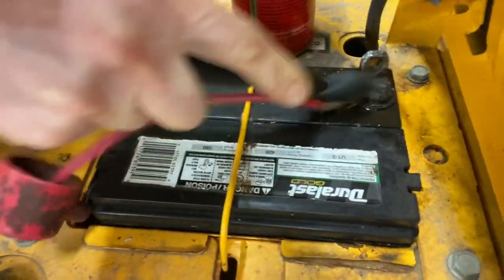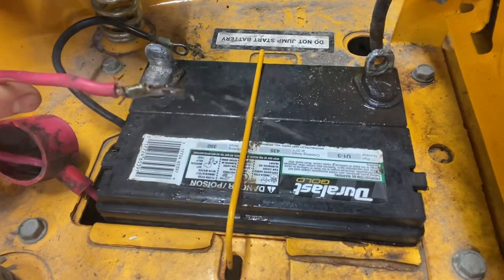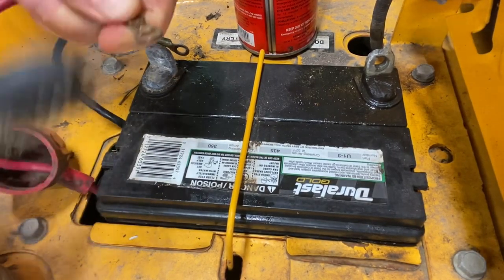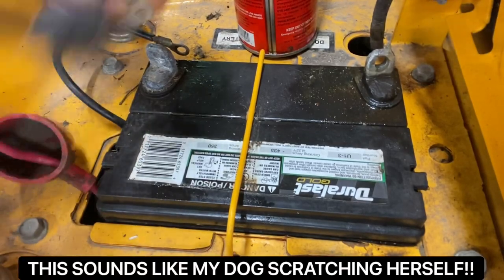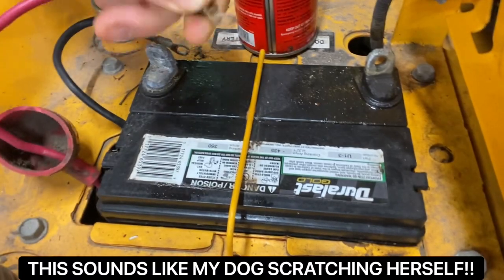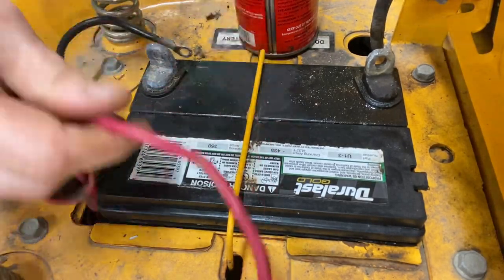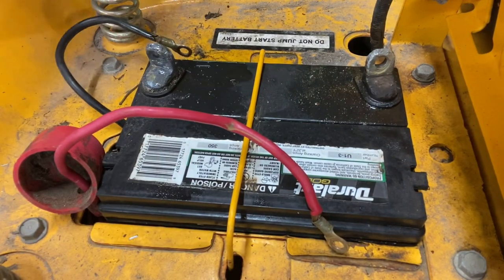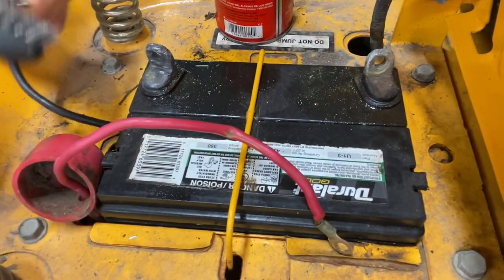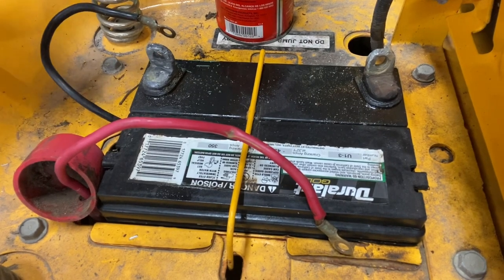As you can see, especially on the positive terminal, there's going to be a lot of corrosion, a lot of nastiness. Hit that, and then go ahead and hit your terminal too — your little wire connectors. A lot of times those get rust and all sorts of nastiness. You want to hit it until you get it shiny, because once it's shiny that means you're getting a good connection. Look at that — shiny! Then go ahead and hit both sides, and then hit the negative. Usually the negative's not nearly as gnarly as that positive. And there we go — we should have a good battery connection. This is very important: if you crank and you don't hear anything, clean your connectors on the battery.